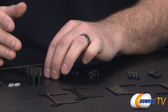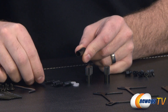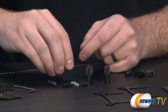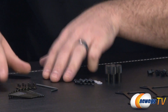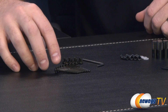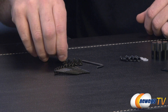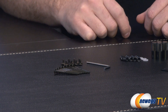From there you have the four rods sticking up, and you'll simply use these little thumb screws. You pop in a spring, thread down a little washer onto the rod, and then you simply hand tighten that down as snugly as you can. Over here on the right, you have the mounting hardware for your fans or your radiator, depending on how you're going to be mounting them. You have some longer screws — eight of those — that you can thread through the fans into the radiator, or if you're mounting the radiator directly to your case, you can use the smaller screws. All of those are going to be tightened using a little Allen key.